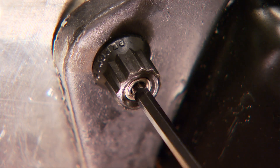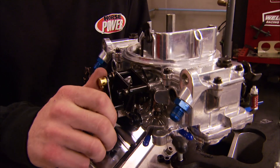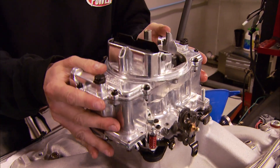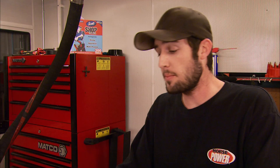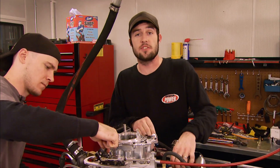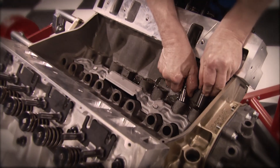To feed our Olds, we're using a Summit 750 CFM square bore four-barrel with mechanical secondaries and a manual choke — the same carb we used on our 464. The EPA has determined that ZDDP and phosphorus in motor oils can destroy catalytic converters and emission systems. The downfall is that phosphorus and zinc are the two main active ingredients in oil that fight wear protection, and without them it's extremely fatal with flat tappet cams and lifters. Since we're working on an Oldsmobile, Joe Mondello wants us to run his special formula added to motor oil so we know we'll have a safe break-in. All of these products still contain zinc and phosphorus.